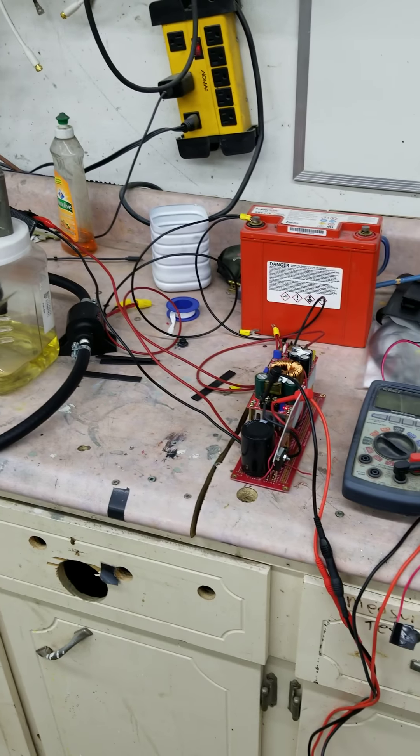I'll show you — I'll hook it up and show you it working. Okay, here it is now. Fuel's pumping. Now I'll actually activate the injector. I'll hook up my automotive injector tester to the battery, start it pulsing, and then connect it to the ETEC amplifier.